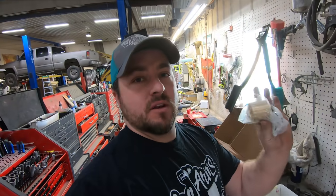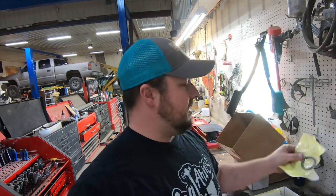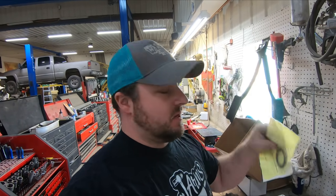I've got the case back in here. We have the seals and bushings for that front hub. Hopefully there are no surprises - I did not get bearings for the front planetaries and I did not get universal joints, so if I pull it apart and find they're bad I'll have to go another direction. I need to take the wheel off, take the hub off, and start inspecting things. Right here I believe is our culprit - this bushing went out, and I think this is the main seal that went out.